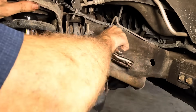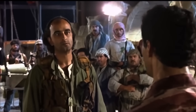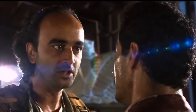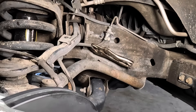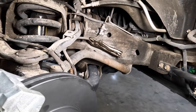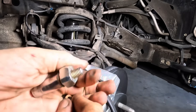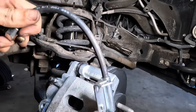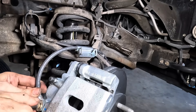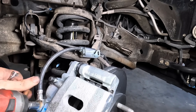My light is out of battery. Get another one before I kill it. Light repowering on — we've had a battery change. I've got the hose here and I'm going to do this one in kind of a reverse order. We'll throw our banjo bolt on first because this thing is kind of flopping around. We'll get this side on first, get that guy bolted down and tight.